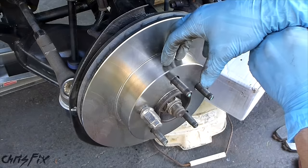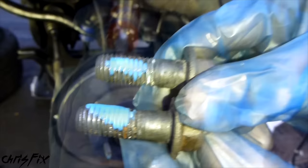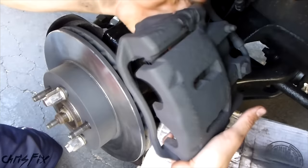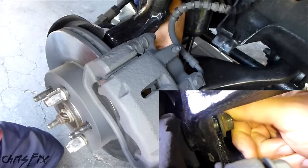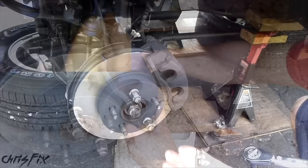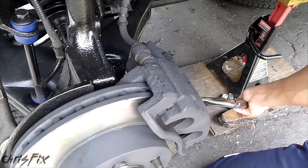I actually painted my brake caliper — if you want to see how to do that there's going to be a video link in the description below. With the brake caliper dry we'll mount it back onto the knuckle. We get the caliper bolts and add some Loctite thread locker on each one — that will prevent vibrations from loosening things up. Get one bolt, slide it in and stick it out a little bit so you can more easily align the hole, then hand tighten to hold it in place. Get the other bolt, slide it in and hand tighten. After hand tightening those two bracket bolts, we'll torque them down to 85 foot pounds.